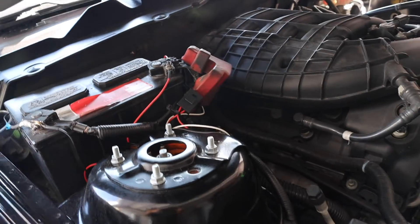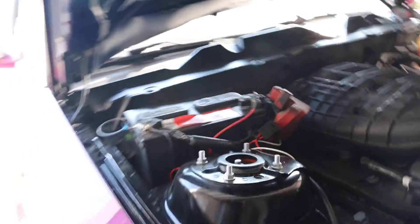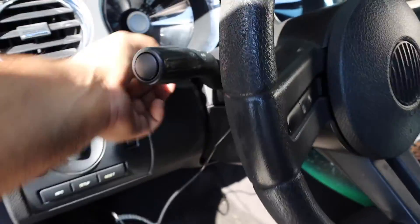Here is a quick walkthrough of what I did. I routed everything as neatly as possible to the fog lights. I took the ground wire and grounded it on the negative side of the battery, then took the two positive wires and hooked them to the positive side of the battery. I routed the wires behind the manifold and zip-tied them in place. Then I pushed the switch wire through the firewall grommet into the driver's cockpit, and put one ground on the fender. I'm still figuring out where to mount the switch — maybe on the steering column or somewhere nearby.